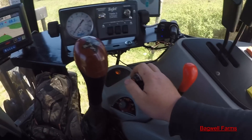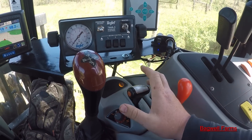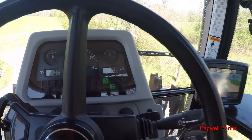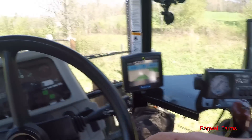I just hold the D-clutch button down or push my foot pedal clutch in, push forward and it'll go to fourth. Now say I want to go back down to third gear — you just push the button in, pull down and it'll go to third gear, dropping back down into third.